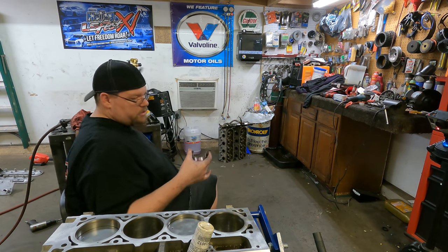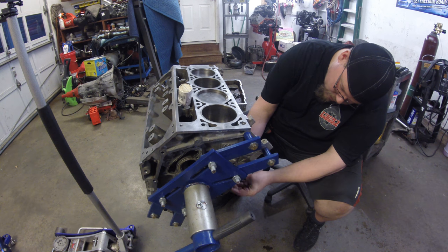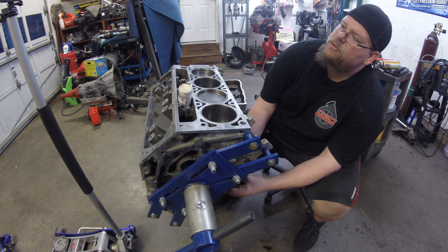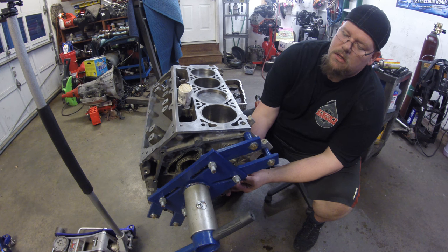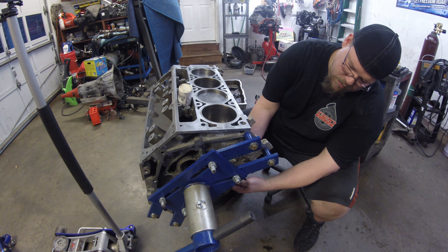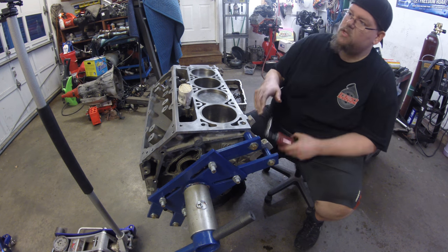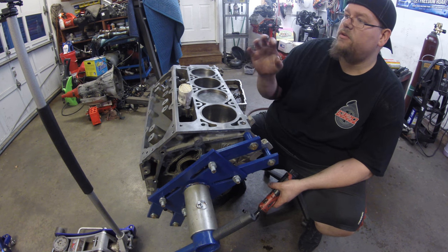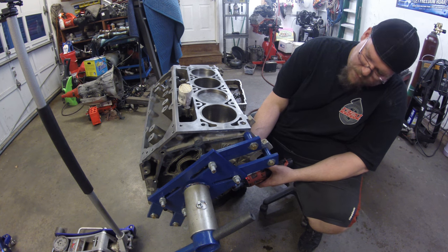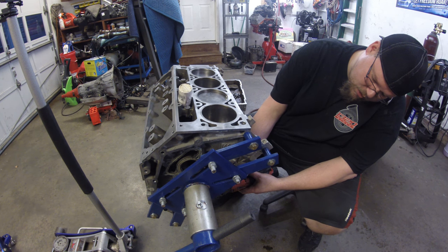So I'm gonna go ahead and put the cap on the bottom of the piston. And I'll also mention on the LS engines, these rod caps are what's called cracked. They're not machined surfaces on the stock rods. And so you have to make sure that the seam lines up on the sides. It's very obvious. If it's backwards, it will not seat properly. So make sure it's facing the right direction. Go ahead and snug the bearing cap down.